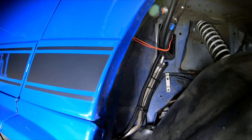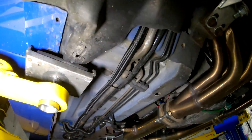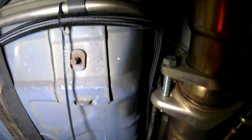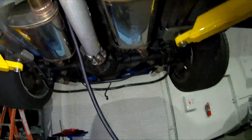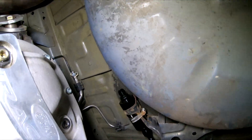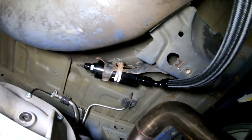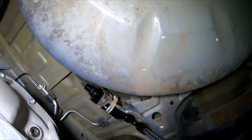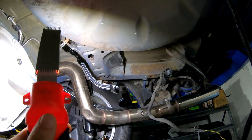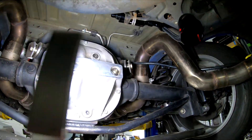Pulled the fender liner down so I could run my new line where I wanted so it didn't have a lot of hard bends in it. It follows the factory fuel line basically up, around, over, and through there. Right now it's just literally hanging down because I've got to terminate the end. Once I terminate the end, it runs up and over right here to the factory location where the filter was. I modified it — bent a few tabs out of the way — so my new filter fits right there. I already made the line here that goes to the gas tank.